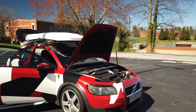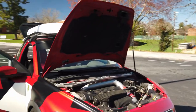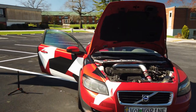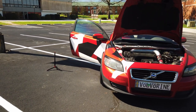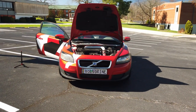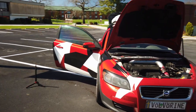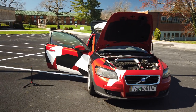One of the biggest gripes I have after the brakes has to do with the headlights — it's so dim, it's like holding up a candle in front of your face. What I've done is put some LED bulbs in there, pointed correctly so they're not blinding people. But that throws an error code on the dash, and you may have to buy an additional accessory to remove that code.